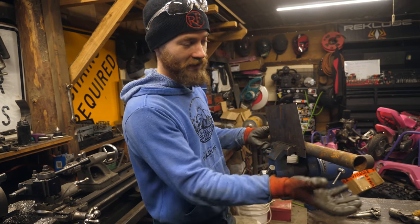We got ourselves some shiny bubble wrap. This looks like an intake manifold — well, that's exciting. This right here is a distributor block-off plate, and what that means is we're getting rid of our distributor and going to individual coils. This is the whole kit from Golby's Parts to convert an old-style 2JZ with a distributor to a modern-style individual coil setup. It's got some shiny adjustable cam wheels, and triggers to send the signal to the computer for the coils. Distributor block-off. Another trigger.